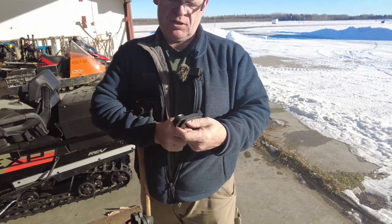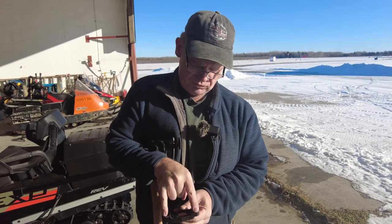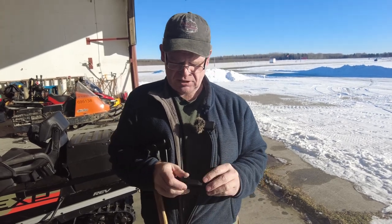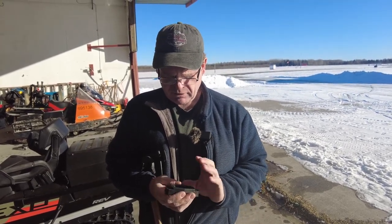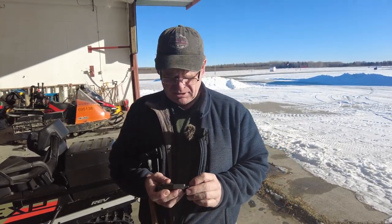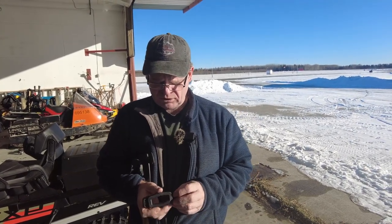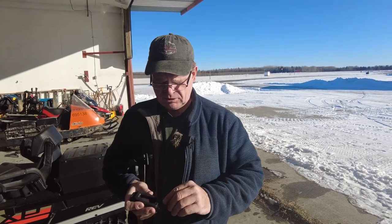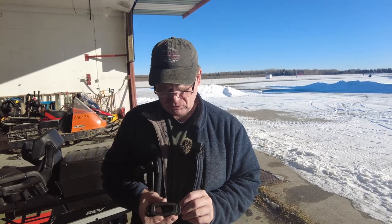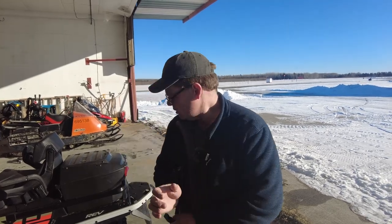This mount is designed to be self-tap screwed from the back side — putting screws in from the back that thread into the plastic holes to the side of the tunnel. However, because we have the heavy duty bumper on this machine we can't really come at it from the back side; it doesn't conveniently work. What we're going to do instead is drill these plastic holes out a little bit so that we can put an 8-32 machine screw through them. We've got some stainless hardware and we're going to mount a rivnut in the aluminum extrusion of the bumper.